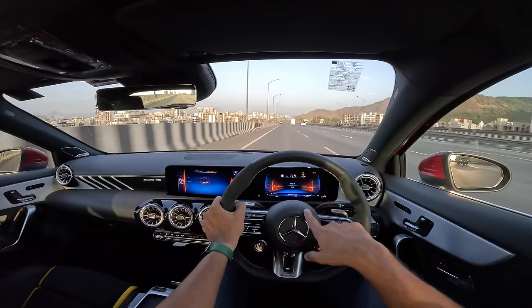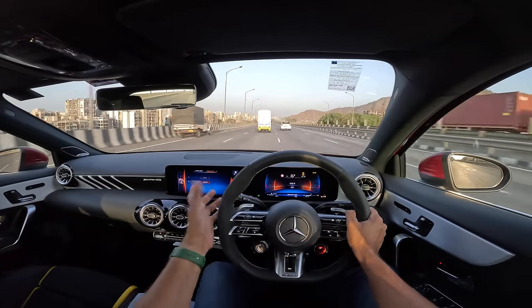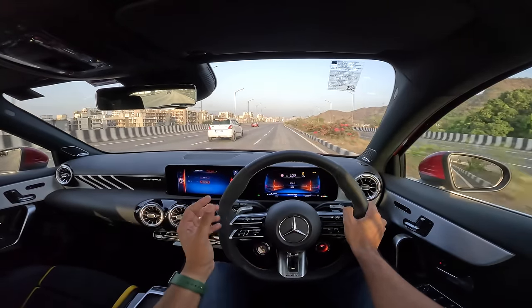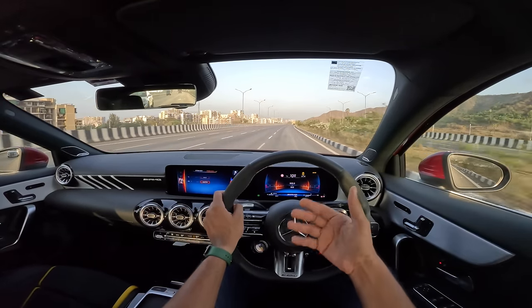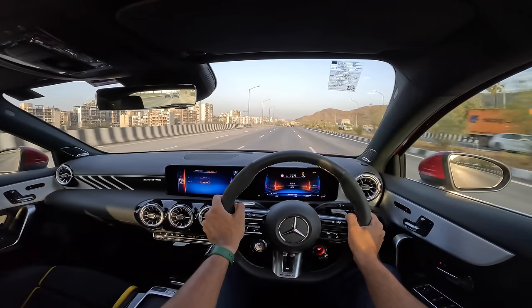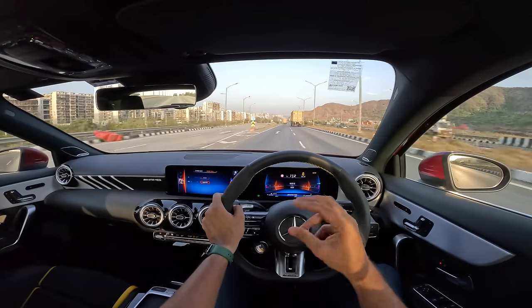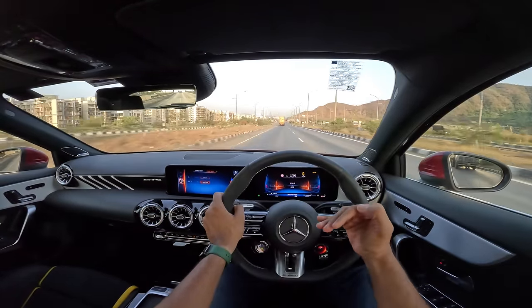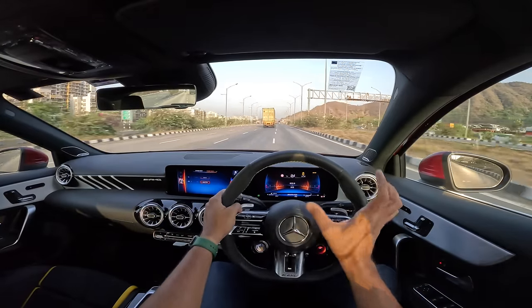By the way, it will automatically make an upshift when you're driving it in manual mode when you do a race start, because then obviously you're in a race, you can't afford to shift gears, it's going to take time. So the car understands that and will automatically make shifts for you as well. So here we're going to get it out of manual mode because it does faster shifts when it's doing it automatically, of course, because the engine revs fast. But somehow the engine, or rather the gearbox or the gearing, is very short. So short geared car goes very fast through the revs, and before you know it, it's upshifted. And when driven at slower speeds, even in race mode now, it wants to upshift if you're not on heavy throttle. So it wants to conserve fuel.